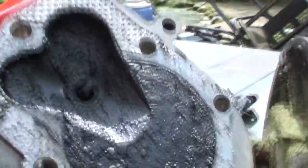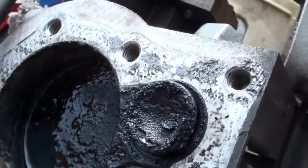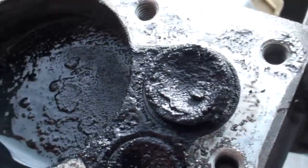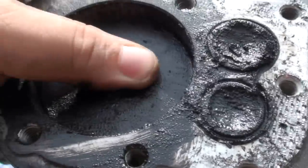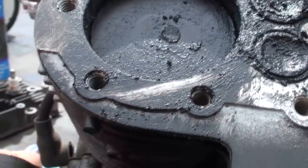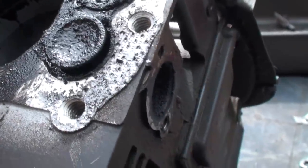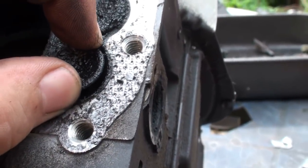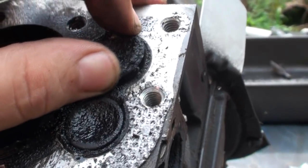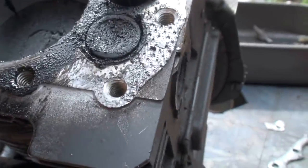The engine was very very oily, and this is obviously due to the lawnmower being overfilled or being turned the wrong way and sucking in oil. I just needed to check the internals of the engine without stripping it down further — all I do is literally wiggle the piston from side to side just to make sure there's no bore wear. The bores were actually very tight so I was happy with that. I also checked the valves, wiggling them from side to side to make sure they have no undue wear where oil can seep down into the cylinder head area. I was quite satisfied that both valves weren't the culprit for the oil in the bore, so I can confirm this would have been overfilled or tipped the wrong way.